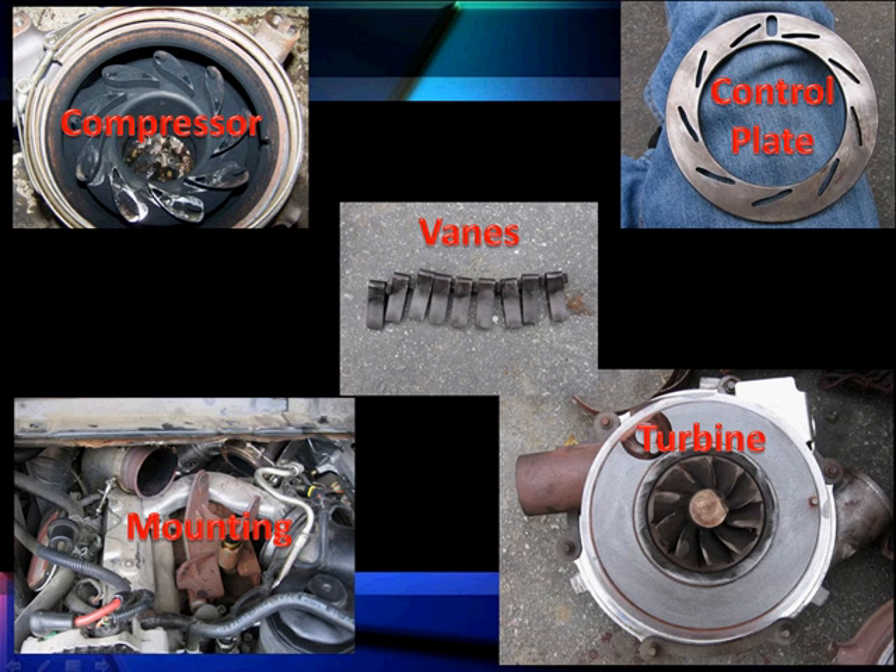Here's our compressor on the upper left — you can see it's starting to accumulate some carbon and dirt buildup, which might need to be corrected. The vanes are in the middle, and the control plate is on the right that moves to open and close them. The turbine is where we get our energy — by running exhaust through it, we get it to spin at hundreds of thousands of RPM. If we put a load on the compressor, we can't get as much speed out of the turbine, which causes lag. If we have a slow turbine and step on the gas, we get turbo lag — that's one of the things we're trying to avoid with variable vanes.